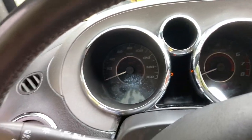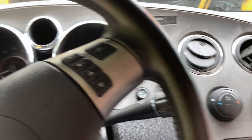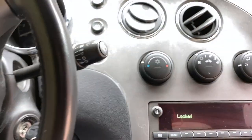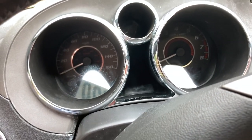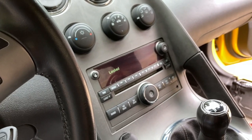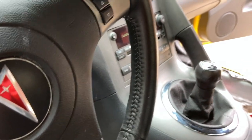Here's take two — got it back in there again. Now it's time to see if we can get anything. Still got the check engine light, looks like. Radio says locked. Oh man! We have a started car! Nothing on the dash — no check engine light, no mileage or anything. But that was it — just the blown fuses. None of the gauges are working at all, not even showing RPM. At least it's running. So we know that's what it was — it was definitely the BCM. Once we let it run a little bit, we'll try to get that pin out and get it transplanted.